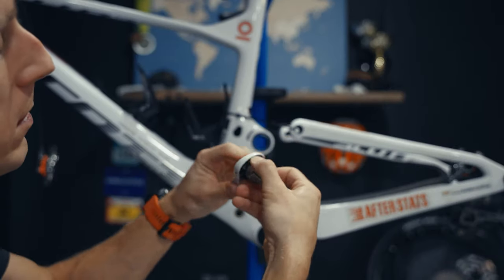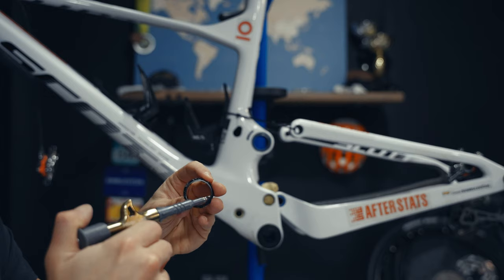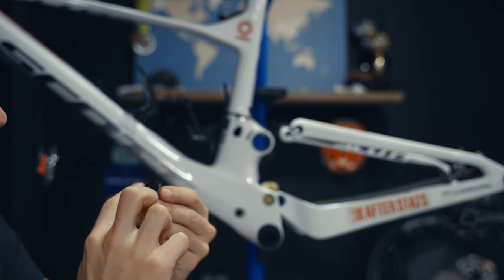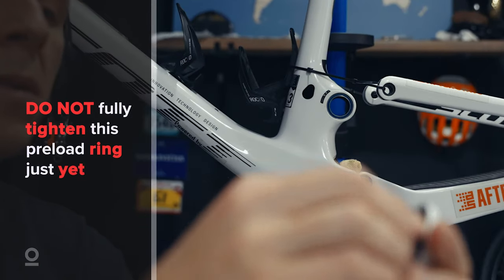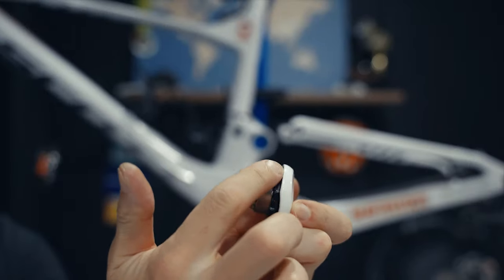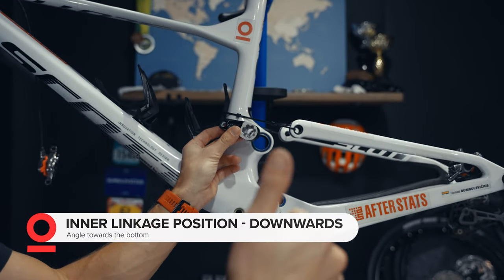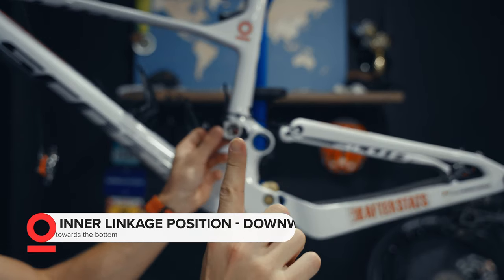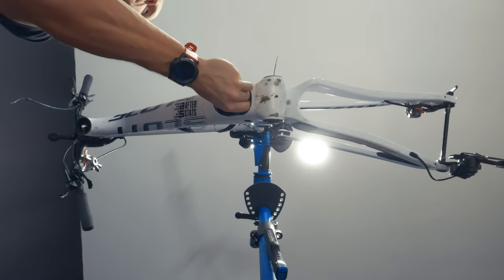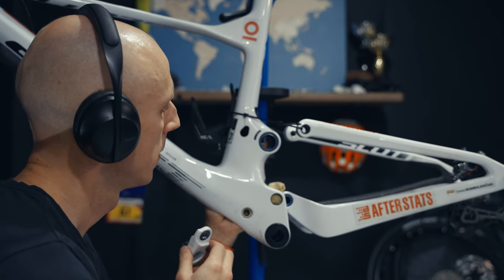It's important to add grease onto the thread before applying it, to make sure rotation is smooth. Important thing: do not tighten it to the full extent just yet because it will control the distance from the frame later down the road. The inner linkage position should be looking downwards, not upwards — so it's an arch towards the bottom. We're applying grease inside the inner linkage, and just to make it stick I'm using a hex key for the time being while trying to work with the linkage.